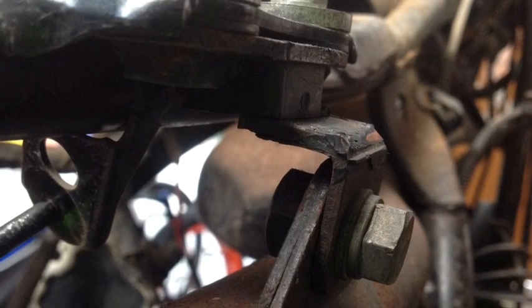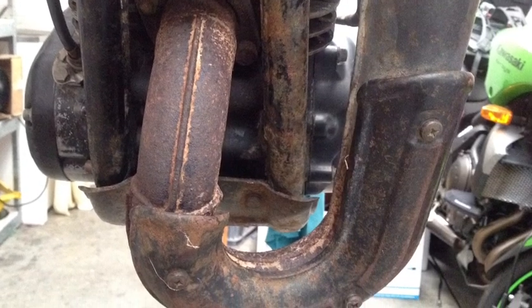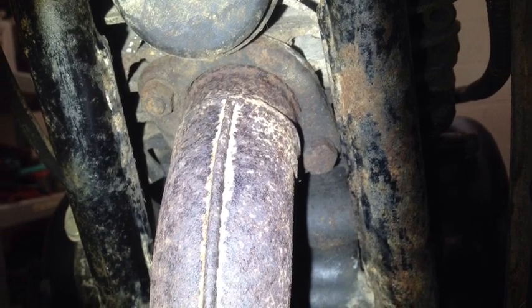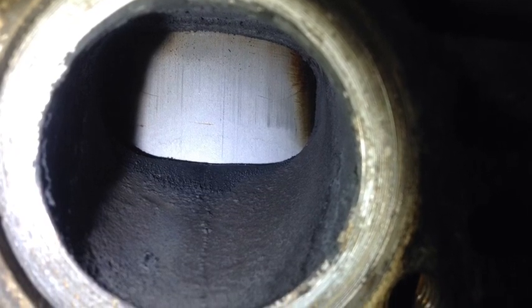That one there, I can't see what's going on at this stage, but it ends up being not even connected. The front's good, it's clean, the rust is not too much. There's a worry though — there's one bolt on the right and one stud on the left, and there should be two studs. The carbon inside is not too bad; I'm happy enough with that.